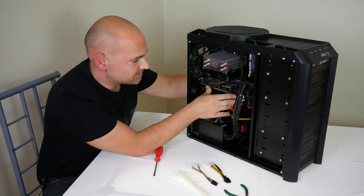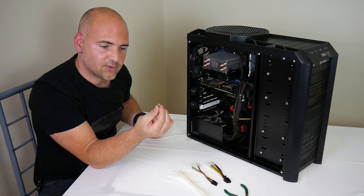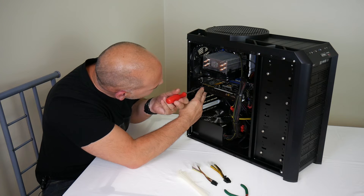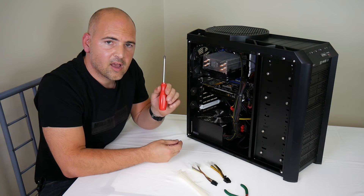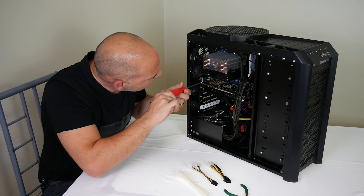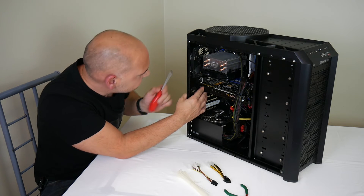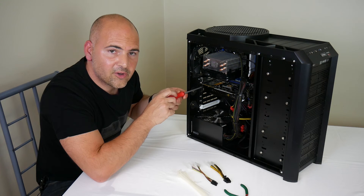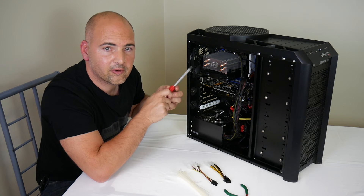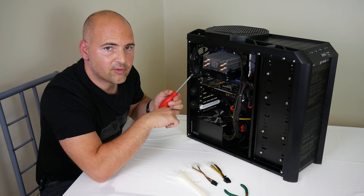If you're doing it face down, that's not a problem. Give the card a little wiggle to make sure it's in firmly. Now take your two crosshead screws and your screwdriver and secure the graphics card. If you've got two screws, it's worth doing the first one not quite all the way tight, just in case the second one is a struggle to get in. Adjust the card from the rear if needed to access your HDMI, DVI, or display ports. When you're happy the card is in the correct position, fully tighten the screws — normally an extra half turn should be sufficient. Never over-tighten these screws; it is only thin metal and you will strip the threads quite easily.